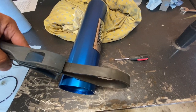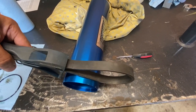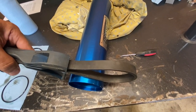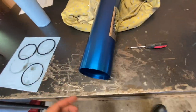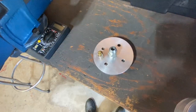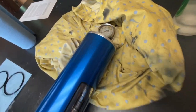I held it close to the edge — not too far in, but just around here — and tried unscrewing the nipple for the NPT to AN fitting, and then the cap started turning, which wasn't really super tight anyway. Alternatively, you could build a special keyed wrench that fits in the hole here to turn it. All you have to do is remove just one side — the oil side, not the air side.